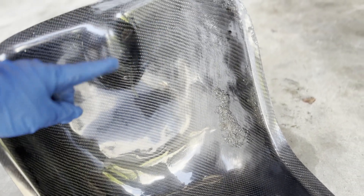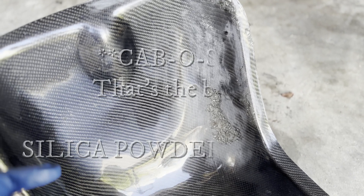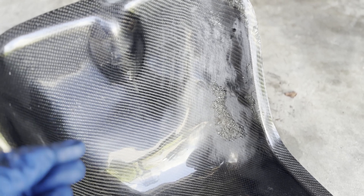We can layer up kind of heavy on the repair and then after a few coats we can sand them back and then pull the tape to start blending it in. Also, this transfers to a lot of composite work — if you guys are doing something in fiberglass you can actually mix what's called Cabosil into your resin and it's almost like a super fine cotton that thickens up your resin so you can use it like a putty and fill in these spots. If it's something you don't care about weight or you're just going to paint over it, you can use that. This repair style also applies to trunks or hoods that get oxidized and beat up.